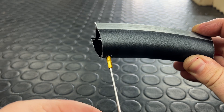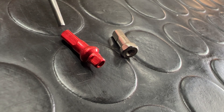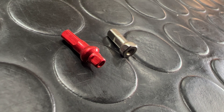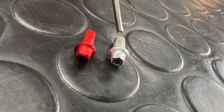Spoke entry angles can't be too high or they'll place stress on the junction between the spoke and the nipple. This can lead to breakages and it's important to consider this when designing certain wheels, especially stuff like e-bike or hub-driven motors. Sapim also offer two types of internal drive nipples, meaning that you can true wheels without the need to touch the nipple flats with a wrench.